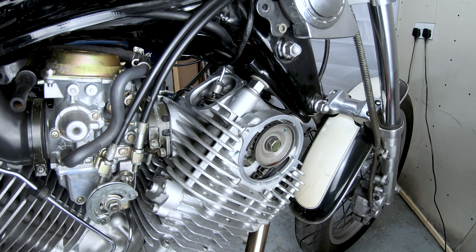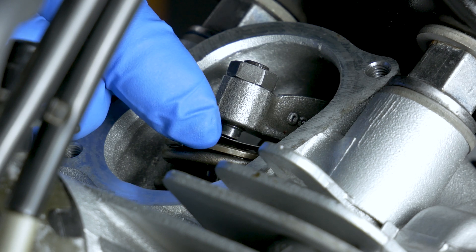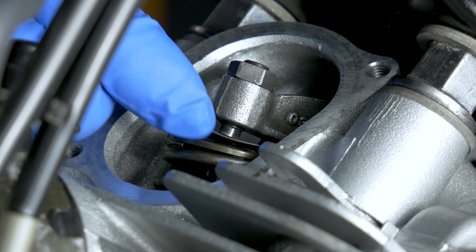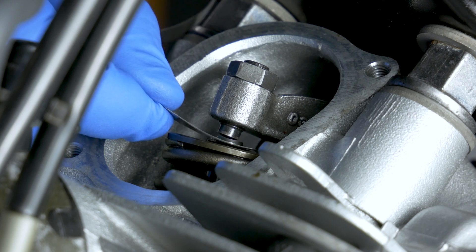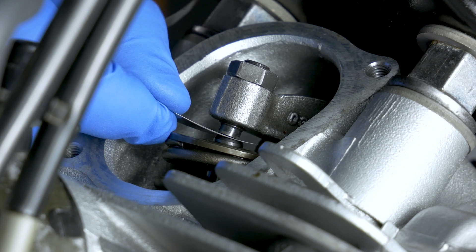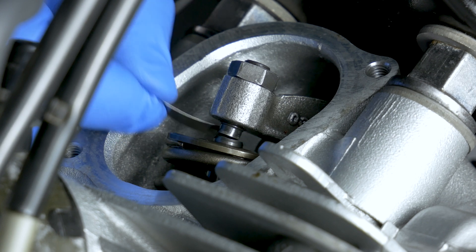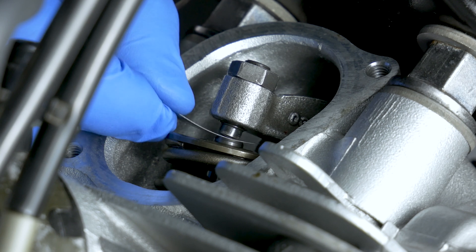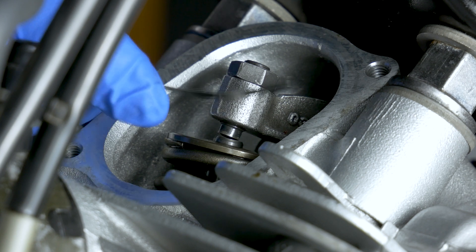It's not the right tightness on the lock nut just yet because I want to test it first. The 0.07 should be loose. As you can see — I'll zoom in so you can probably see it — this goes in quite easily. Let's try number 0.08.